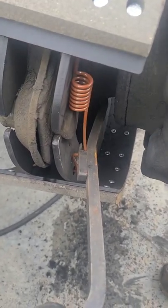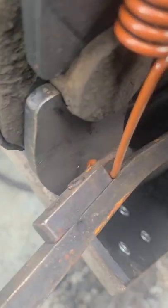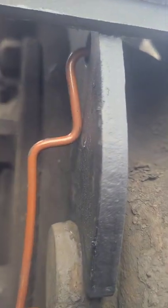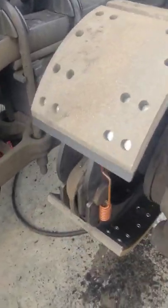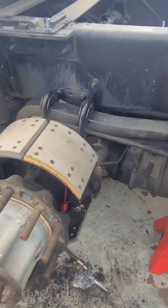Got this one on there — they were on the wrong way so flip them to the right way. Just get the top one on there, hook it, then push down. You can see it's pushing the other brakes over. This side is going to be a little more difficult. If it's not fully seated, as long as you can take a pry bar or a hammer, just knock it back into the rest. I'll use a little hammer to pop it in. They can be a pain — have the right tools and it's much easier.